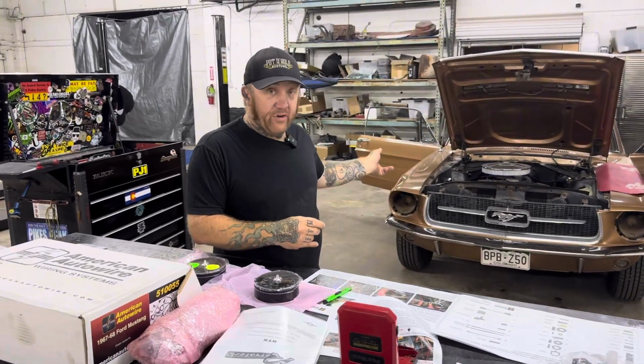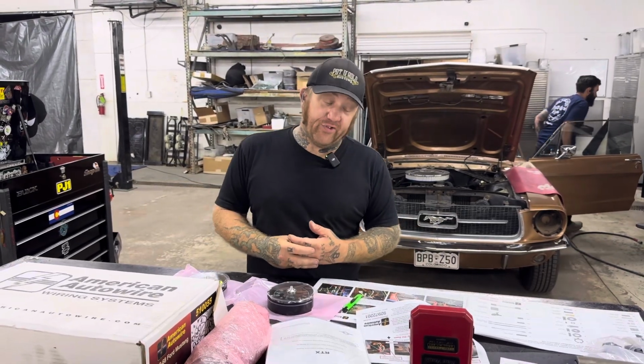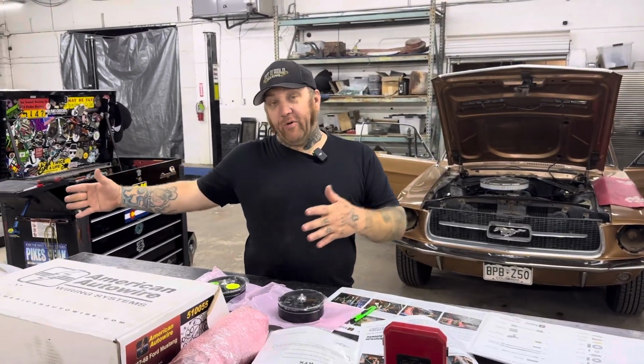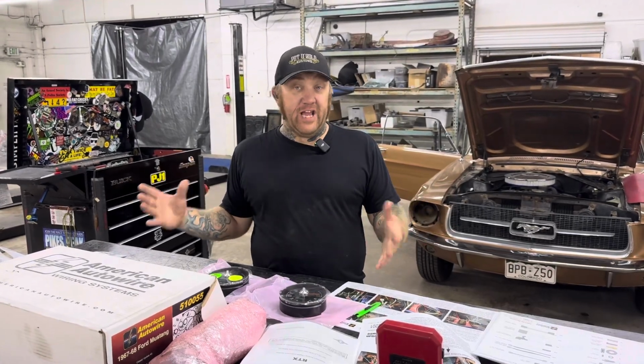This one actually runs a Holley Sniper unit. So you have to think of what it needs, not only power demand-wise, but protection. Electromagnetic interference is a big deal with the Holley Sniper units. Actually, most fuel injection is. With the stereo, you've got the same idea. You don't want that squeaky alternator noise, so you end up routing your wires separately on other sides of the car or running some down the middle, just to isolate them and keep them away from each other.